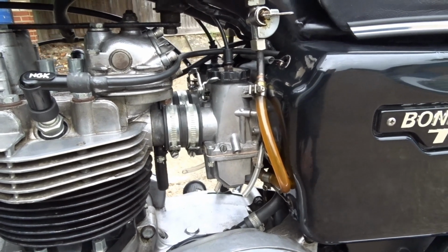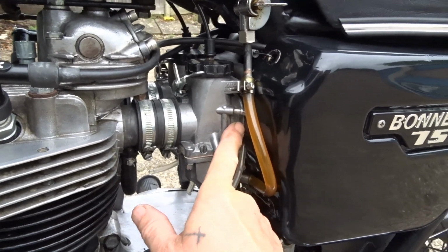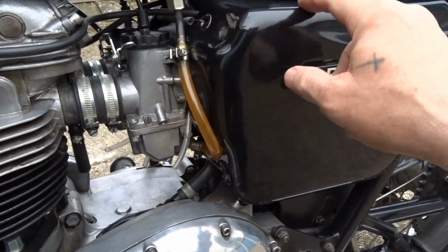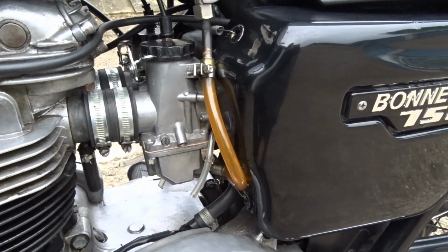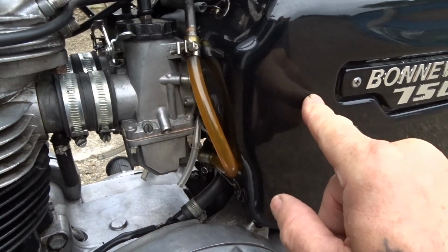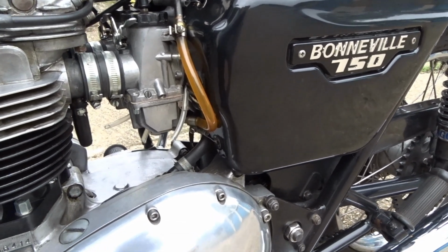So Gareth, you mentioned the sealing rubber in between the carb and the air filter, and I've noticed that on mine. I've just got a bit of plastic tube that slots in there, and that does have a bit of a gap in it. I've also noticed under these covers, the airbox doesn't screw tightly, doesn't make a proper seal, so I need to address that as well to make sure the airbox is completely sealed up properly. So I want to do that. I need to take these 3.5 slides out, put the threes back in, and sort the sealing out on the filter side of things, and then we'll give it a test run from there. So I have to get started on that, I think.